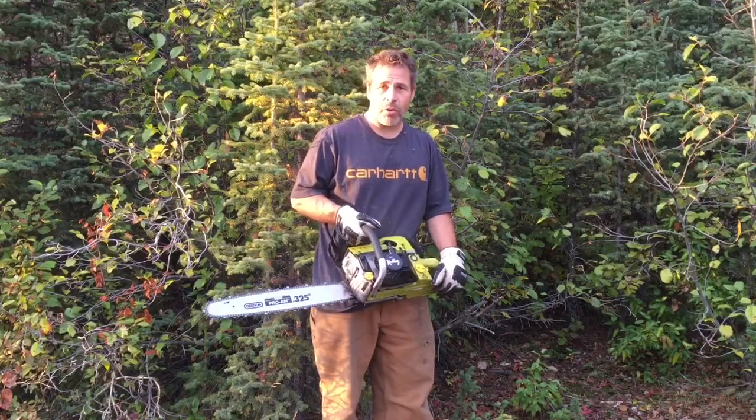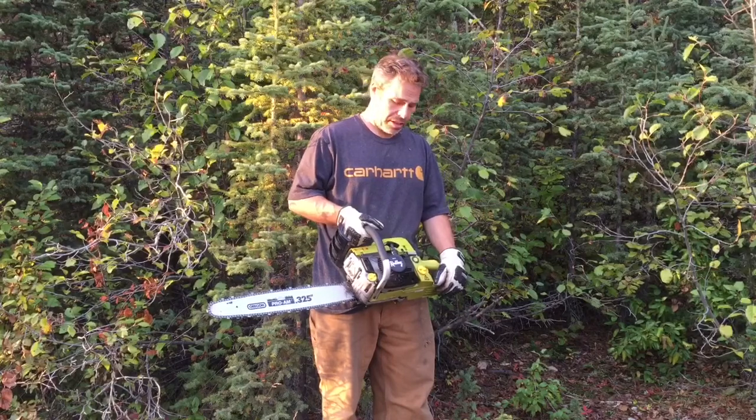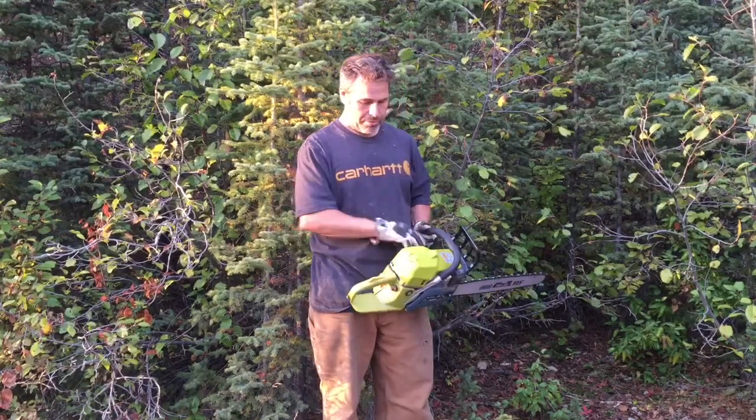I'm going to keep running it at 40 to 1. That's what I run my saws at. They call for 50 to 1, I like 40. And it's easy starting. It's a good machine, good saw.